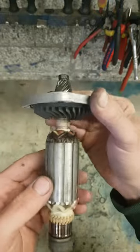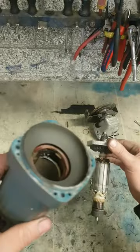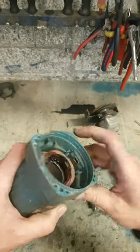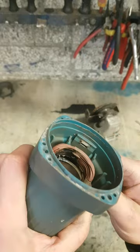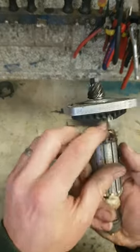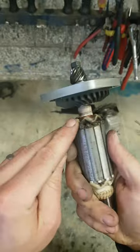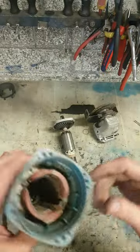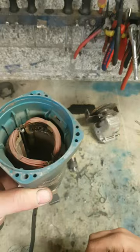That's an odd one. That's an armature — no, it's not. It's the field itself. Normally you get a wee bit of burn mark on the brass, but that's only on the resin. This armature's good — just the field.